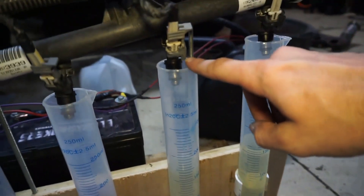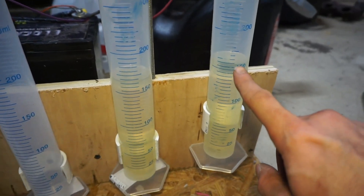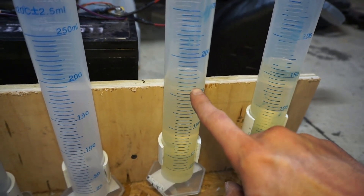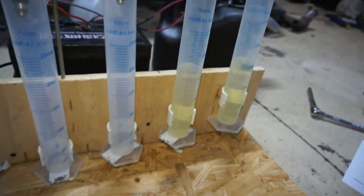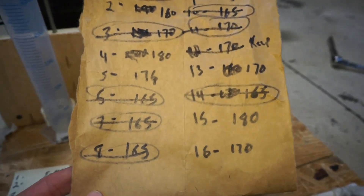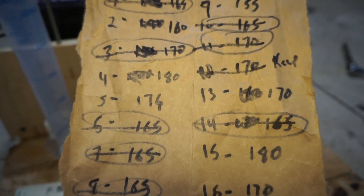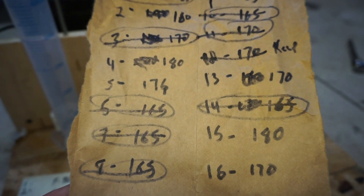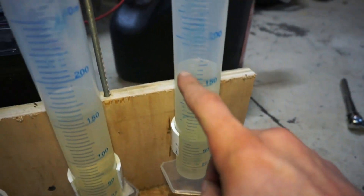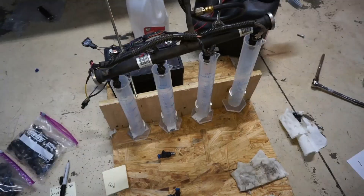We did the first test — this was number five and number seven, the 22-pulse test, the same test I was doing before. Number five ended up at 160 and number seven is right around 165. Comparing that to all the other testing I did, the 165s are actually right in line with the two full sets I did before. So I wouldn't really say that number seven was incredibly lean to where it was going to cause a problem.